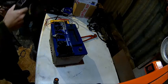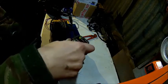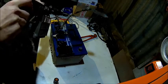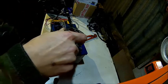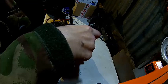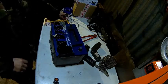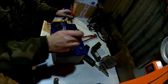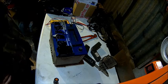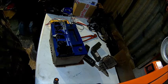At the moment it says 12 volts. If I turn everything off — no load at all — and then apply 50 amps, it's not enough to get anything useful out of it. It's down to 10 volts now and it was fully charged. That was 50 amps for probably about 10 seconds, and down to 10 volts means one cell is lazy. Which is a shame — it's a quality product, or at least I bought it as a quality product. Not much you can do about it.